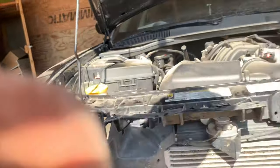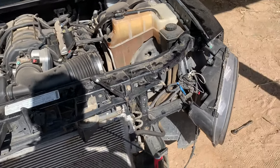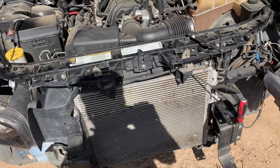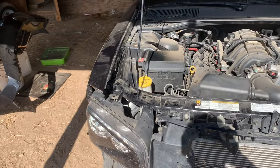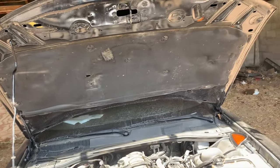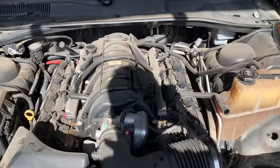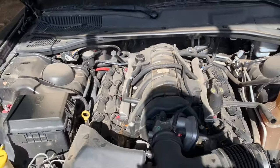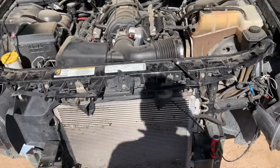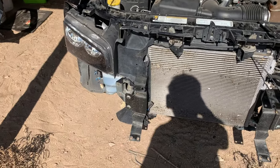And I believe, if I remember right, when I was watching another video, you shouldn't need to remove the radiator. The radiator should stay put while you take out the piece. I recommend if you have a stand holding your hood, you might want to put something on top of the engine to prevent it from going all the way down. That way it gives you some room to work. Alrighty guys, I'll get to doing the rest of this